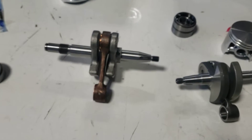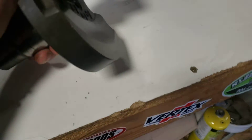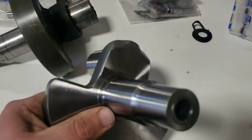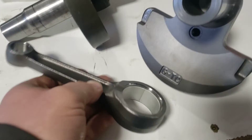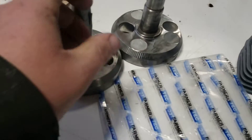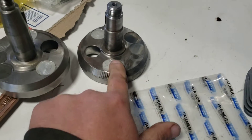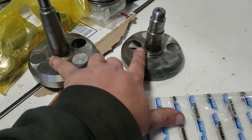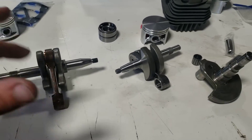We don't really rebuild chainsaw crankshafts anymore unless you're stroking them or doing a long rod kit. To illustrate the design difference: here's one off a Polaris Razor 800 — same thing, no pin to press out, the pin is incorporated into the web, so if it goes bad you replace the whole piece and put the rod on. Here's a Kawasaki motorcycle crankshaft — the pin presses out of both sides, so you can reuse both webs and just buy a connecting rod kit with new bearings. Anyway, that's aftermarket chainsaw territory now — you can just get Chinese aftermarket parts.